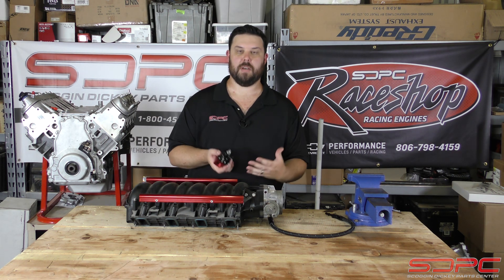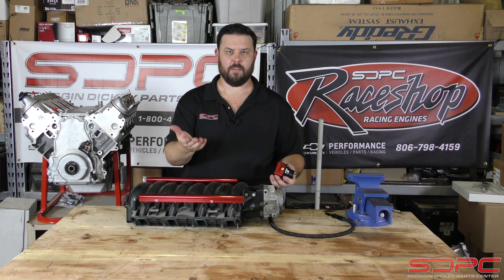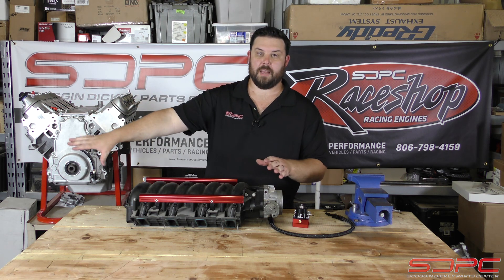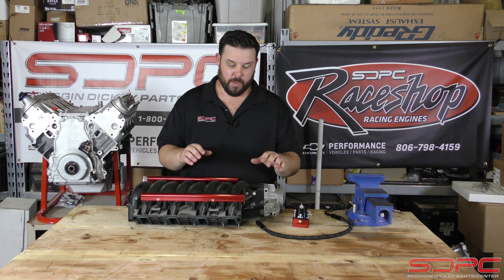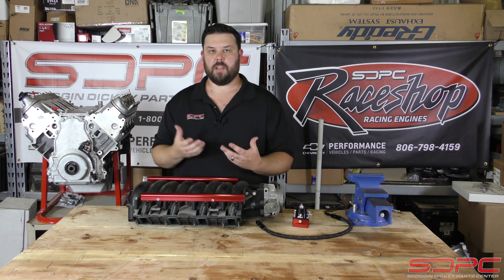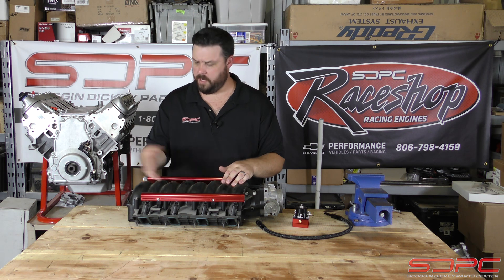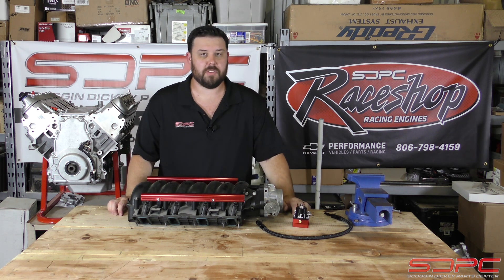But what I'm going to be talking to you about today is going to cover the whole range of it. Now, if you remember some of our other videos talking about the fuel pressure regulator and filter combo — the one that came in the C5 Corvettes, used for swaps all the time — you usually put it far back at the gas tank. Pretend this intake manifold I have here — it's a spare LS6 on a spare engine — pretend this is on the car, the nose of the car, and the tank is over off the side of the camera. It seems like that's put kind of towards the pump and the gas tank in the back, and then it's just one hose that comes up here, tees into the fuel rails, and then you plug off here, so it's sealed and everything's good to go.